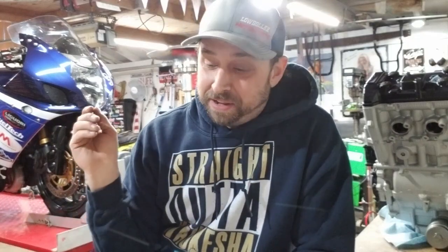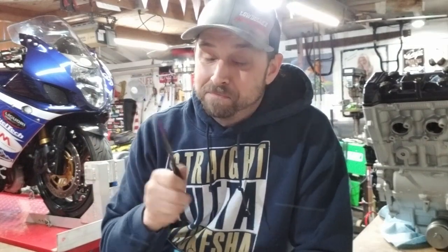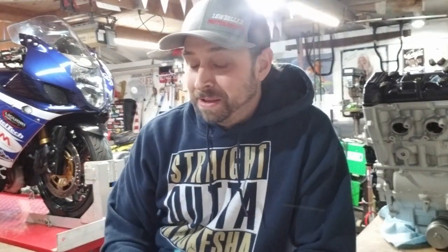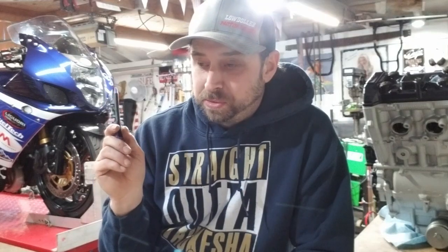The turbo that's on it is, like I just said, a 57 millimeter. Pro Street legal is 62. I don't need that. Not for our local track. But the 57 millimeter on this motor, and the compression that I run, is basically why I have boost on tap and it makes power instantly. I can put this thing on the two-step, it'll make 15 pounds in 1.3 seconds. And that's pretty decent.